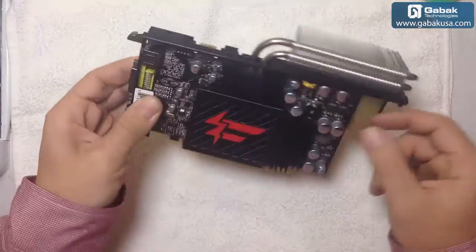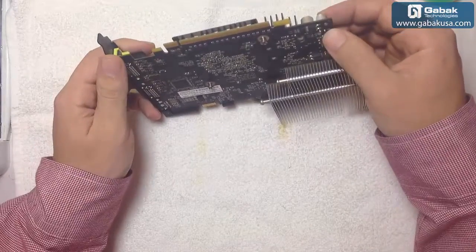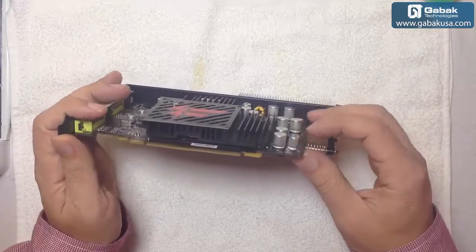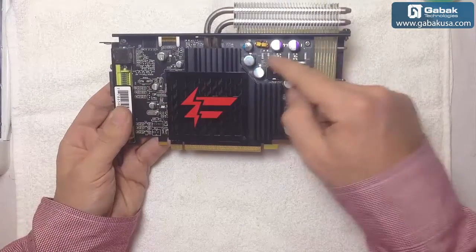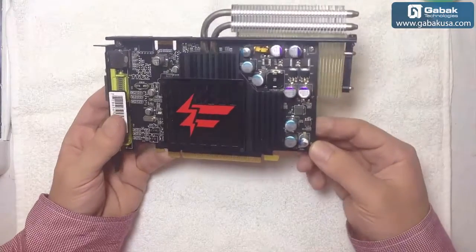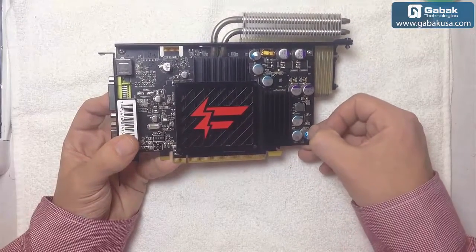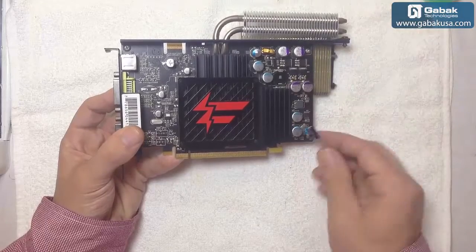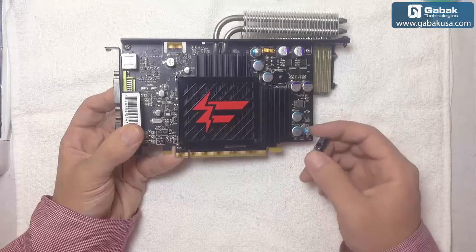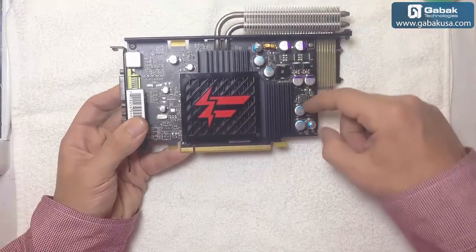On this part we don't have any issue — we can just unsolder from here and that's it. So we can start with this one and after that we're going to take it apart and replace the other one. Remember, this strip line as you see here is the negative side. The short leg is negative and the long one is the positive side, so you have to keep that in mind.